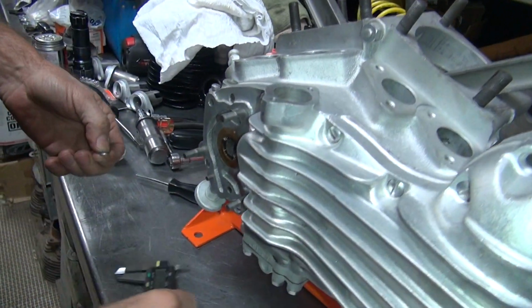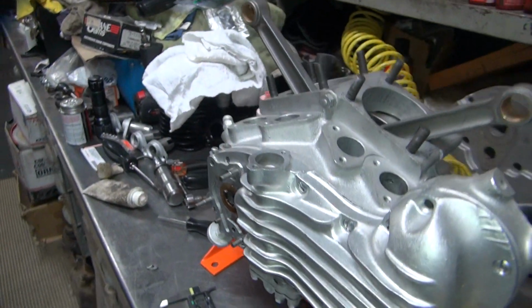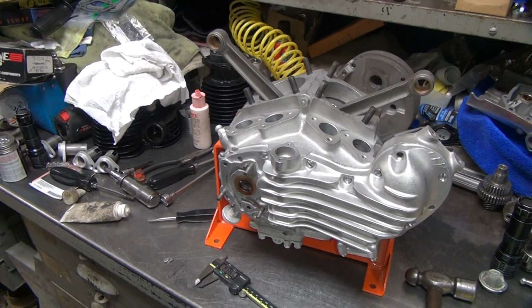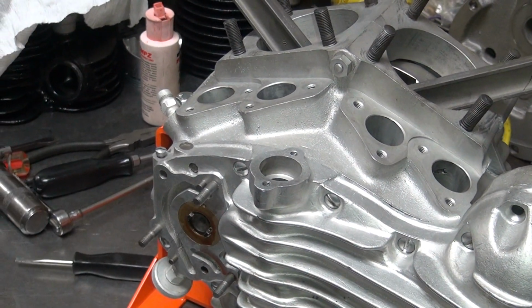78 thou. So it's still a little short on one turn out. So we're not sure how much it's going to need until you run the bike. The other washer I found was this one, but I think this was used on the points. This is pretty thick, so this just gives you a rough idea. That's 35 thousandths.